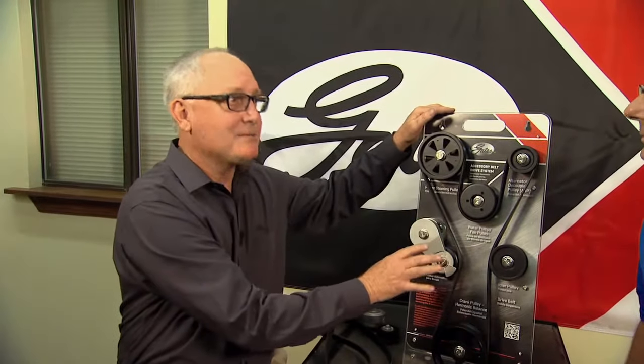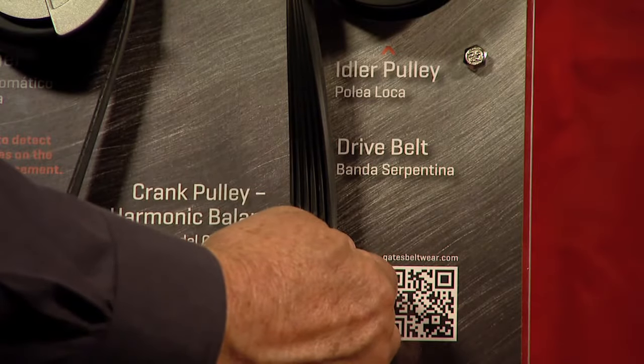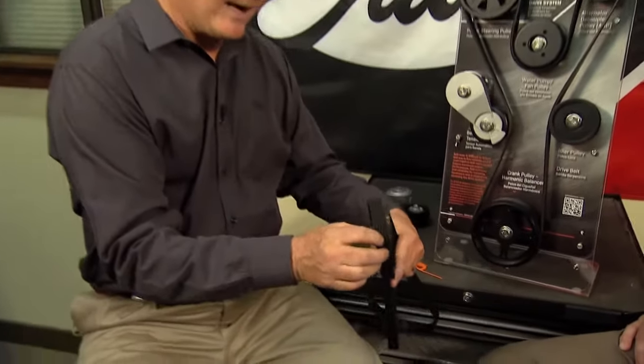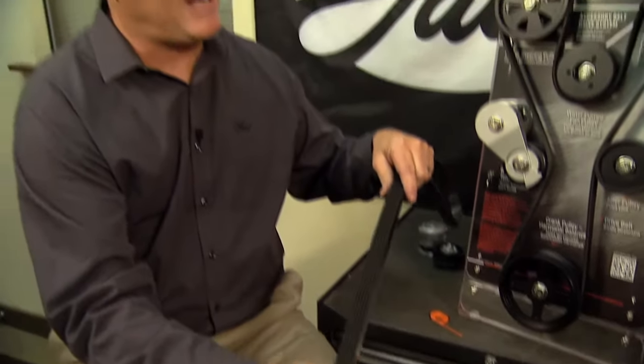So when a belt slips today, it's either through loss of belt wear or from a failing tensioner. So let's spend just a minute and explore that if we could. I brought this example with me, and I'd like to show this to you. This belt has over 114,000 miles on it, but yet it still looks brand new to the technician.